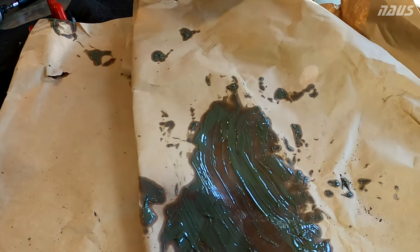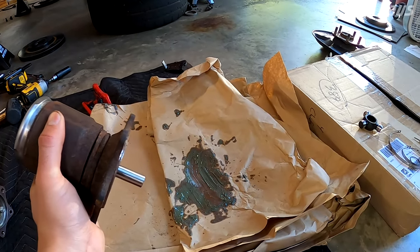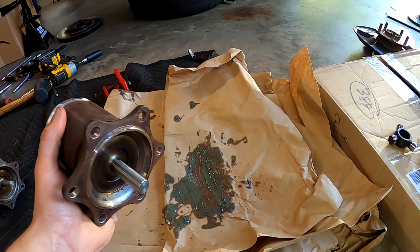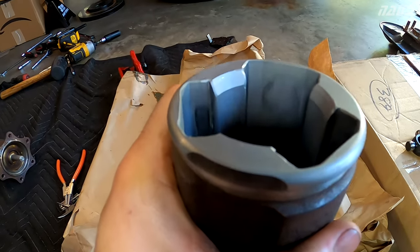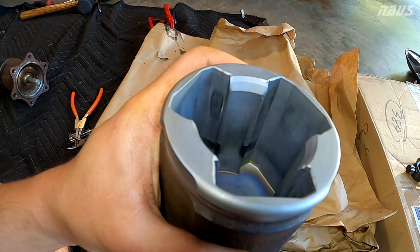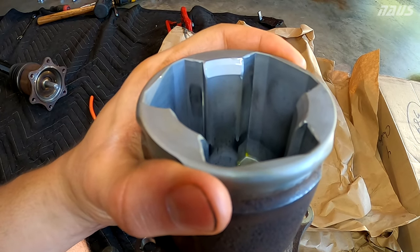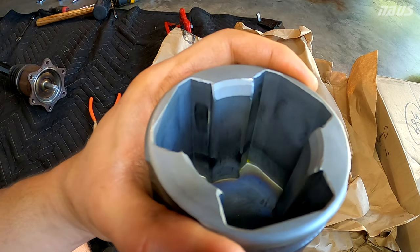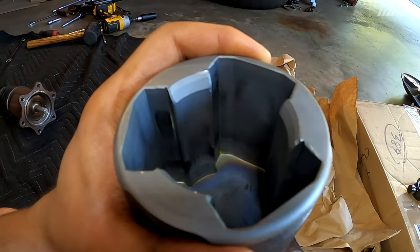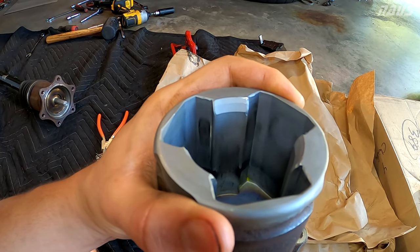The grease came out in a dark green color. When it goes in, it's yellow — the OEM grease is yellow — so I assume it discolored from metal shavings in it over the years. I'm pretty surprised to pull this apart and see almost no wear. On these contact surfaces, there's a mark where the rollers contact, but almost no pitting has started yet. It's definitely visible where the rollers were contacting. Some people that run these to 200,000 miles have severely pitted axles and get an acceleration vibration.